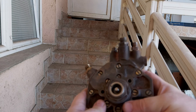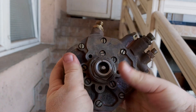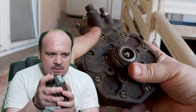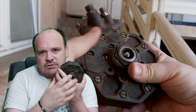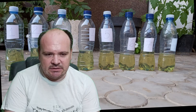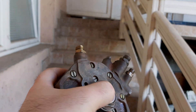So what does this mean in real life? It means the engine would run with a very rough idle — if it idles at all. It also means the fuel distributor is clogged, slightly due to corrosion, and that the cleaning needs to be repeated. This kind of result is your warning sign.